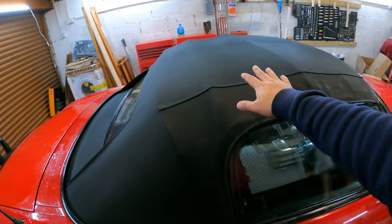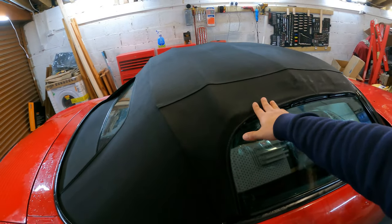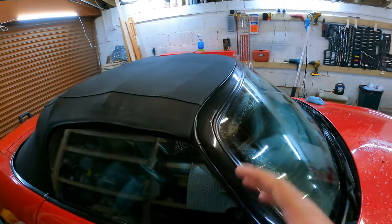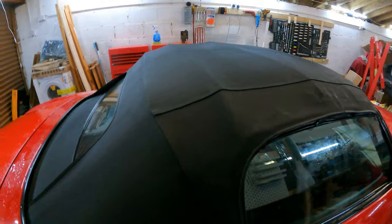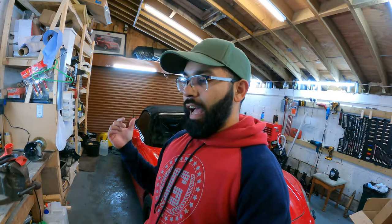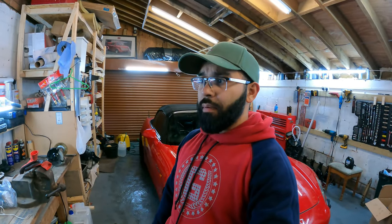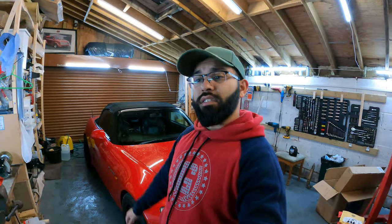That's how it's come out looking so far. I noticed this area still had a little bit of mold so I went back on attack mode on that — it looks to be okay. Once it's fully dried I'll be able to tell for sure. I went over it with a microfiber cloth — a tip I got from Ammo NYC — which is one of the best ways of getting rid of moisture. I'm going to let this dry now with the heater inside the car circulating heat upwards. I'll come back in a couple of hours, check on the car, and see if it's ready for me to apply the sealant. I'm going to use the Fab Seal on this — I think that's going to give pretty good results.